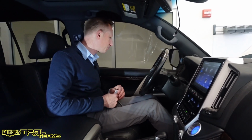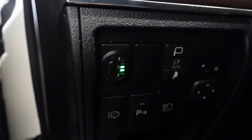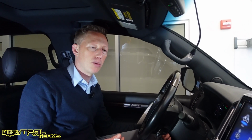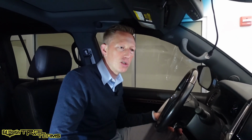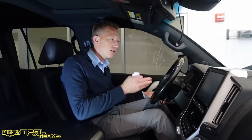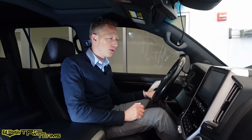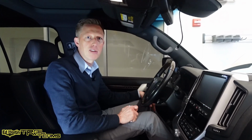That's already installed. And then over here, we have the auxiliary fuel tank power switch. When you press the button, it'll turn on. After it's finished transferring fuel, after about 3 minutes of a dry run, it's going to go ahead and shut itself off. It is 24 gallons, and the stock fuel tank is 25 gallons. So if you're driving down the road and your low fuel light comes on, you can press the button. About 20-30 minutes later, you'll have a full tank of gas, and then your aux tank will be run dry.